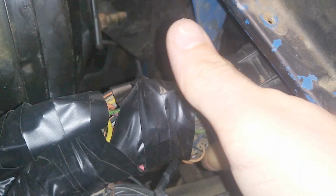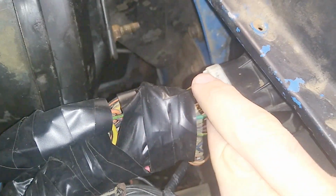I also kept the wires for the check engine light and wait to start light. If you're not trying to integrate a lot of the Powerstroke harness into your project, you can always cut off the wiring for the firewall connection and only run the minimum wiring. I chose to use the firewall plug and instead cut the individual wires out that I was not using.